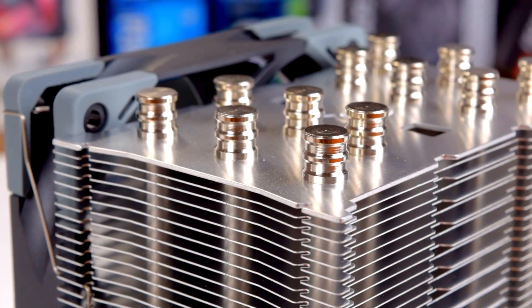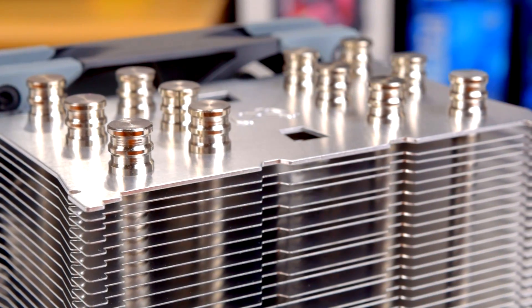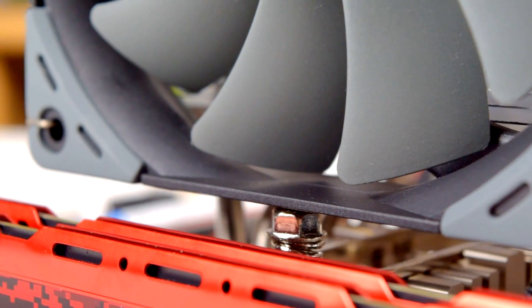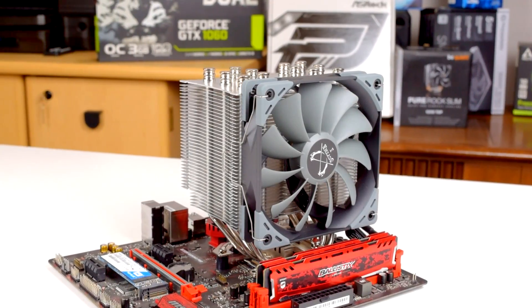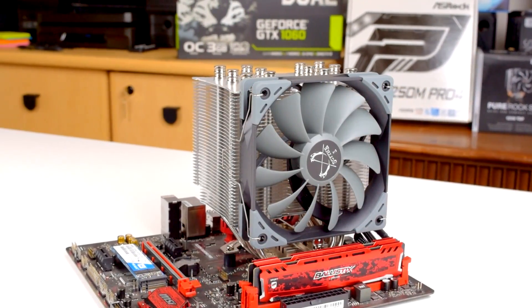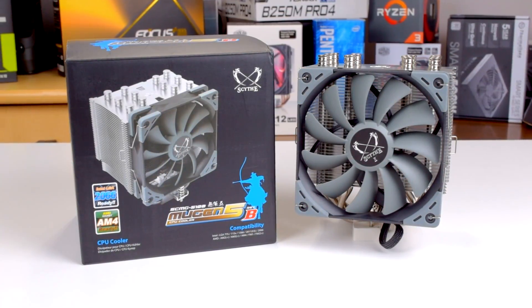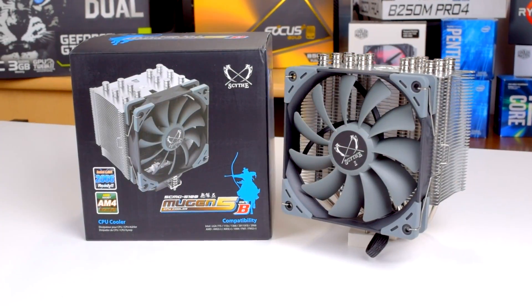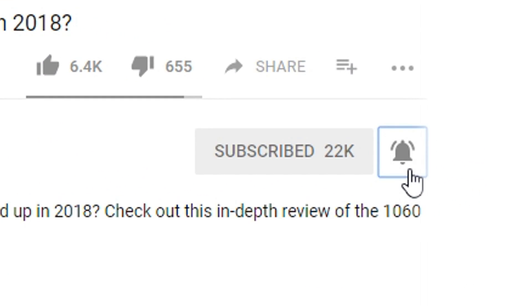The Mugen 5 is one of the better overall CPU coolers I've tested and one of the best in terms of noise. It's big, but includes smart design choices that make RAM clearance a non-issue. It's heavy, but the installation brackets are secure and really easy to install. You won't be breaking any overclocking records with the Mugen 5, but it was designed to handle a reasonable overclock while maintaining whisper-quiet acoustics — and it does exactly that. It's unfortunate that Scythe doesn't have a bigger presence in the US, but the Mugen 5 is available here and it's a solid performer. Click the link in the description to pick one up, and hit subscribe and click the bell icon to get notified of new videos.